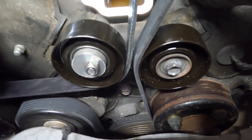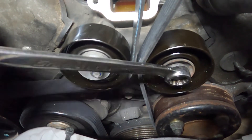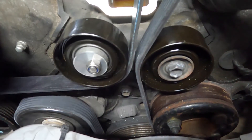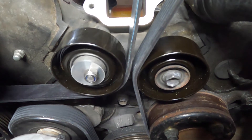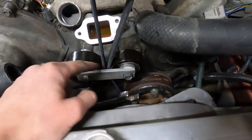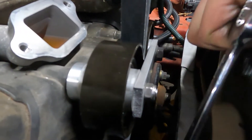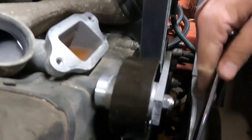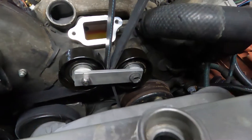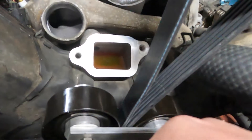We've got to connect it from there to there, which means I'll need a longer stud. Running a plate across it will make it annoying to get the belt off and if the belt comes off it'll probably eat it, but that's alright. I just went ahead and made the bridge off-camera, and I also made another spacer with the hole centered so we can see how much it flexes now. I don't really see it moving much — most of the force is gonna be pushing it that way, so that may get it done. But it's so close I should have made these a little taller — I'll probably just remake them, but I think for the most part that gets it.